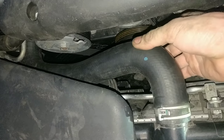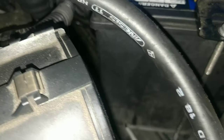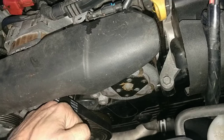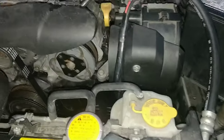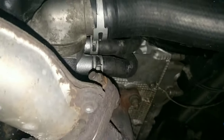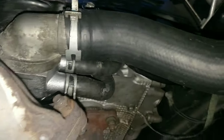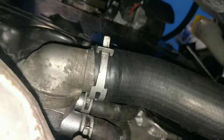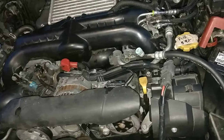We can't do anything until it cools down — there's a lot of pressure in there. Maybe we have something hooked up backwards. I feel like the temperature would have risen in the car, but not if the water isn't circulating — it'll eventually light up. I wonder if one of these hoses down here are switched, or maybe the thermostat's sticking. I don't know if that temperature gauge is actually real — some gauges are fake and don't move until you get really, really hot, then they automatically peg.